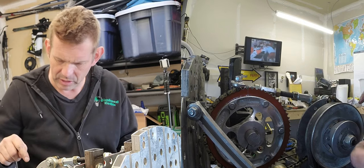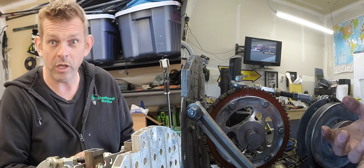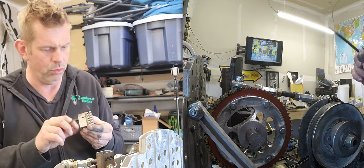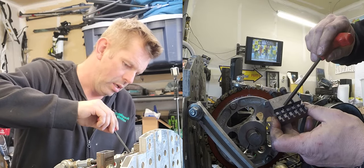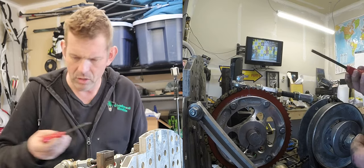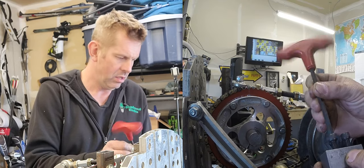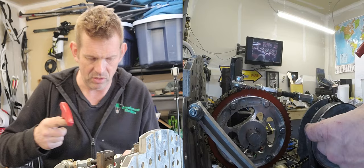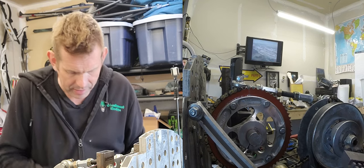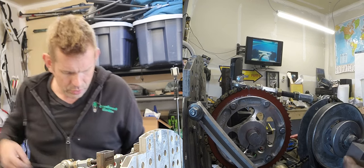What we're going to have to do is get the other side of the chain broken. We're going to use a chain breaker. So that's a chain breaker, and what this thing does is it has two little screws — they poke into the chain to either remove one of the pins or put it back in. You use it with a hex key, and that's what makes this thing work. Some guys do it with an impact wrench when they want to do it fast. I'm not that guy, so I'll do it the standard way.